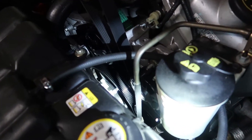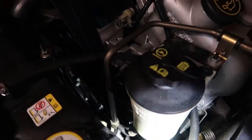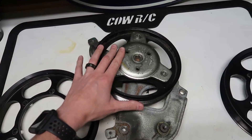That's why I'm going to go to a bigger pulley — if these two were spinning at the same speed, this wheel would go further than that wheel because it's just bigger. By doing that, we feed more belt and it's going to allow us to spin the supercharger faster. Whether you have an upper pulley or a lower pulley, we're trying to spin the supercharger faster, because if we spin it faster, theoretically we should hopefully be able to get more boost — up until a certain point because superchargers have an efficiency threshold we need to stay within. Going back to my car, that 12 pound lower is huge — it is 10.55 inches. The six pound lower is 9.1 inches, the eight pound lower is 9.55 inches, and a stock lower is 7.5 inches. As we go up roughly 0.5 inches, we gain about two pounds of boost — though that works up until about the eight pound mark.